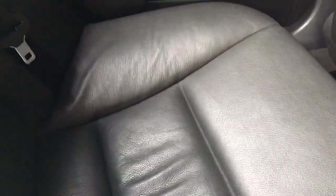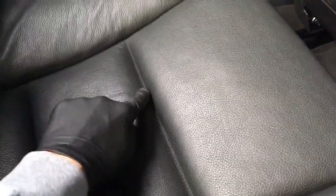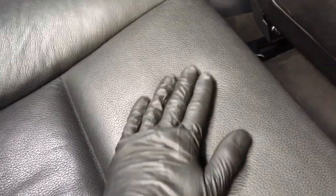When it comes to looking after your merino leather we're going to look at doing two things. The first thing is you want to get the leather nice and clean before we do anything else. Over time we get dust and dirt stuck in the seams of the leather — it ends up a bit like sandpaper, real abrasive. People getting in and out of the car all the time can actually start cutting away at the leather and the stitching, and you'll often see on older cars where the leather has started to split. So it's important we get all that dirt out. Also, with people sitting on the seats, you get muck and dirt on the face of the leather, plus oils from people's skin finding their way into the leather, which can be quite detrimental. We want to get all that muck and oils out of the grain structure.